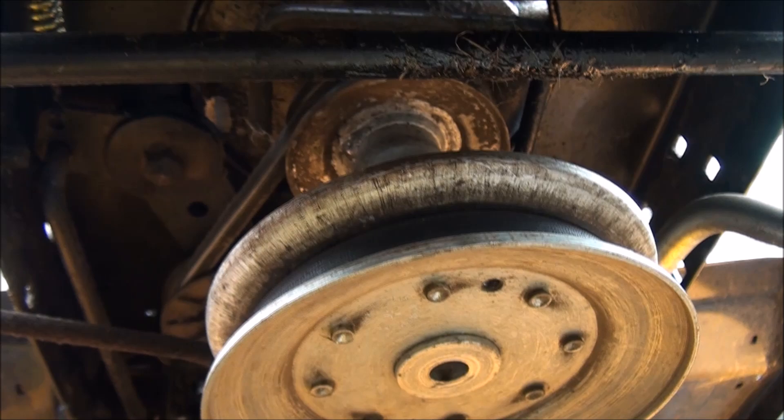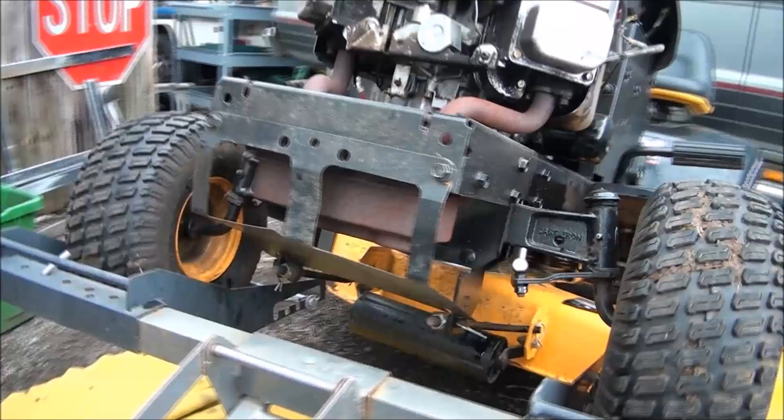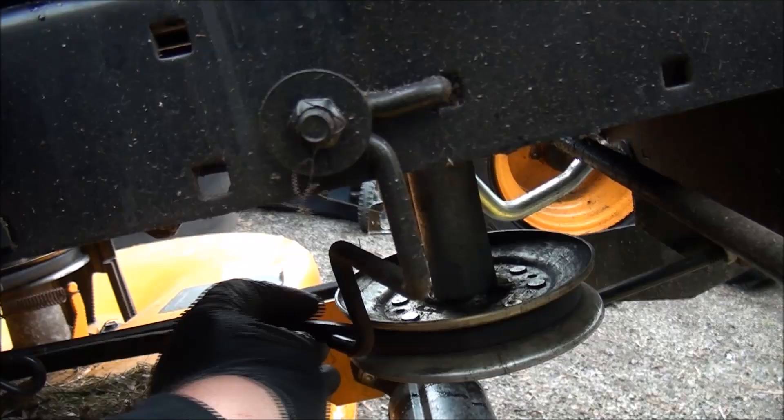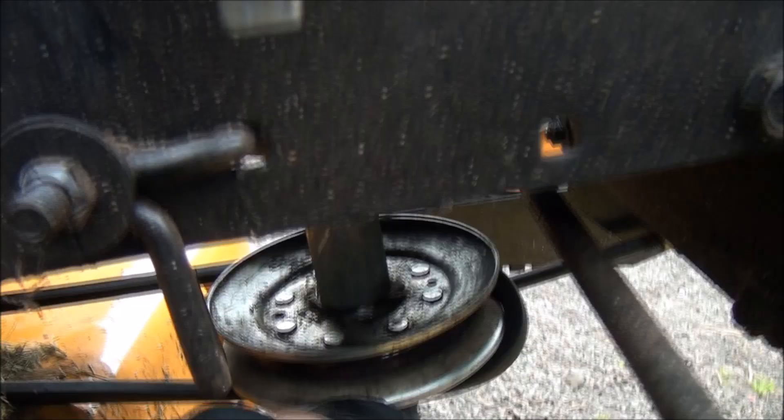On this one you push down the brake and you lift up this lever while you're doing it — that locks it in place. Now that should have loosened that drive belt. Let's go ahead and take the deck belt off — it's usually pretty easy, you just take it out from the keeper and work it around and it comes right off. Do you see how loose that drive belt is now that we put on the parking brake? So that should just be able to slip right off.